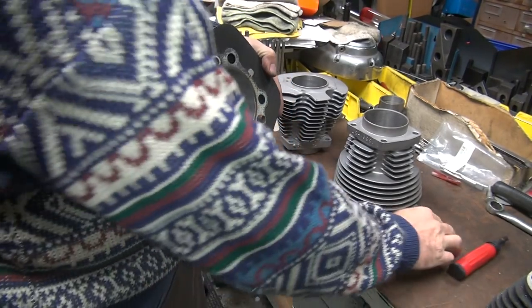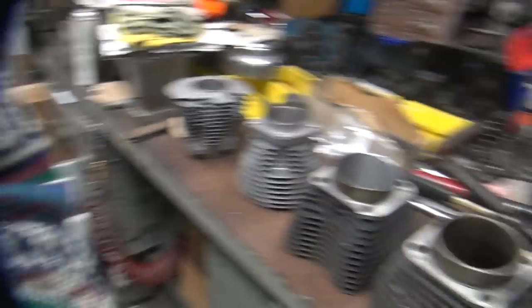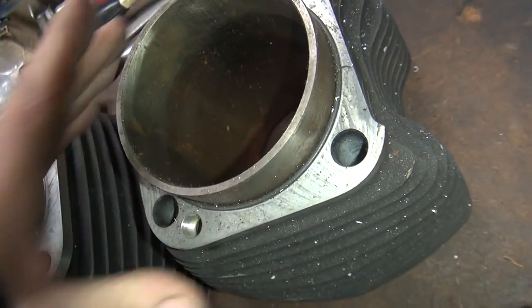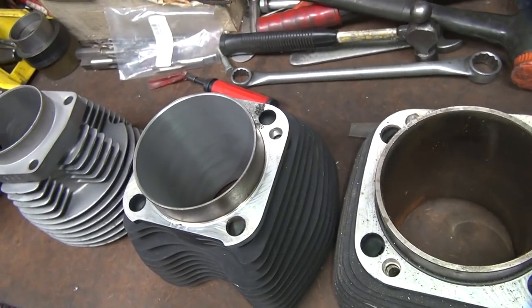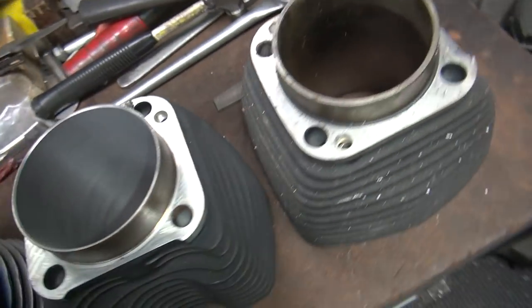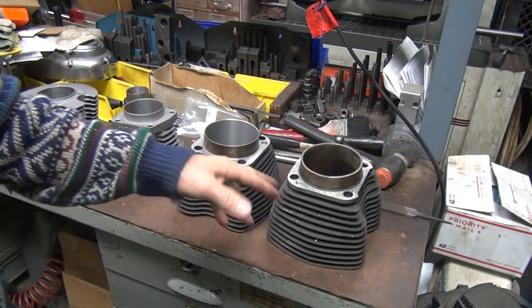Top fuel drag racing out there. So there's the cylinder all done - before and after. No more rust. That one's good to go. So I've got to decide what I'm going to do with the cylinder - I don't have any job for these extra ones laying around just rusting. I guess I'll wind up buying some pistons and put them in the holes. They're pre-set so whoever comes in next for a bore job, we've got a set to exchange out if they want to. Just do a click hone to match their pistons and good to go. I'm going to go ahead and clean these all up and bore this other one. I'll be back.